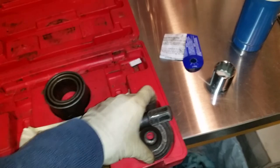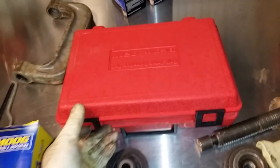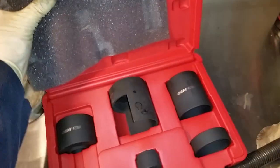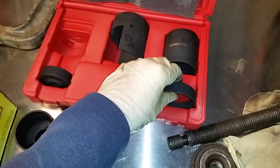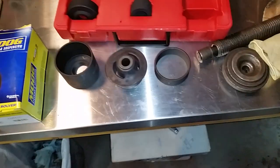What we'll be using out of this kit is this ball joint press — put that aside — and this, and this. Now to get a better fit you could also use these sleeves, but I like to use this kit over here which is OEM 27166. AutoZone has this also. These are different size sleeves and cups. I'll show you how to use all these together to press this bushing back in.